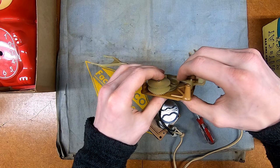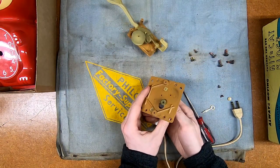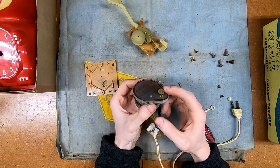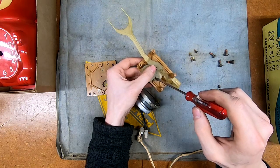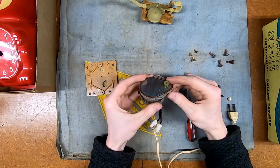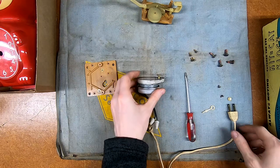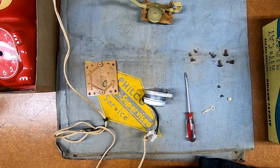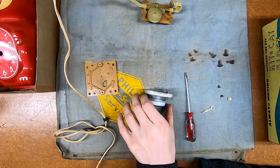If I take the backing plate off, the drive gear actually has this little nub right here and that's going to engage with this slot in the eyepiece, and that's going to drive everything. I'll probably wipe all these parts down - they look a little gross - just clean all that up while I'm in there. I can just plug this in for a moment and see if this pinion spins. I don't think it does. Big surprise - we've got a whole lot of nothing going on. That should be spinning at a decent rate in order for the eyes and mouth to move.